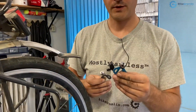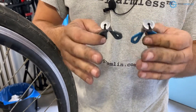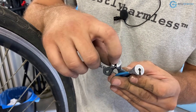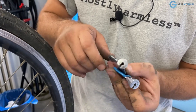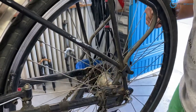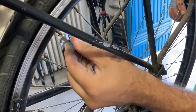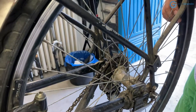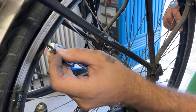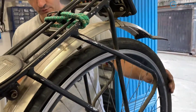For 3.3mm and 3.45mm spokes, those spoke keys are usually a good fit — especially the ones that catch the nipple on all four sides, as they don't risk damaging the nipple. I'll use the smallest one that fits: the 3.3mm doesn't fit, so the 3.45mm — that's a nice tight fit. Now going to the right-hand side of the wheel to tighten the spokes.